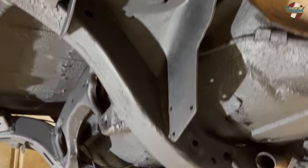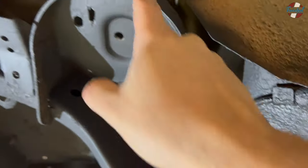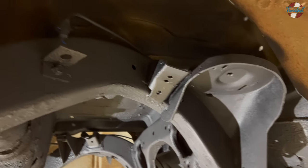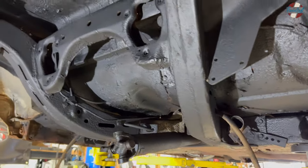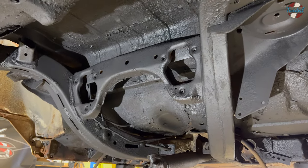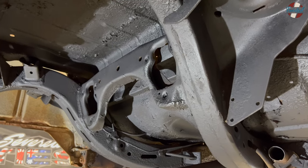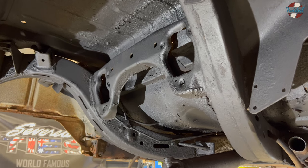We're about to run a new fuel line — we've pulled the old line off, and it snakes over to where the gas tank's going to be hung. We're about ready to put the rear suspension arms in, then put the axle up and bolt everything together. That way we can measure for the rear shocks and also make sure we've got the amount of drop we want out of this thing. So let's get the axle mounted and move on to the front.